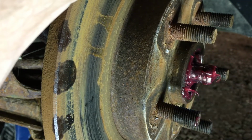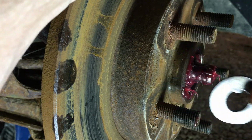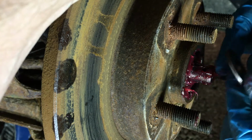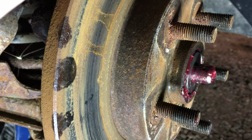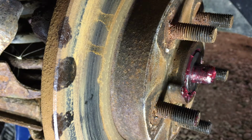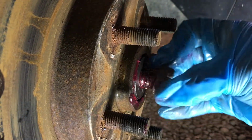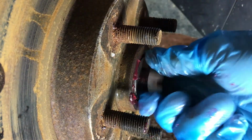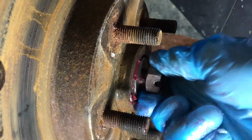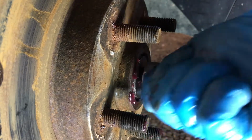She's good. Next, you take your keyed washer, and we can see it for sure now. It's got that key on it. There's a groove on the top, so we'll have that key go on. Okay, that's greasy too. And then we take our castle nut. Make sure that your indentations are outside, facing you. It goes on a lot nicer once everything's clean.